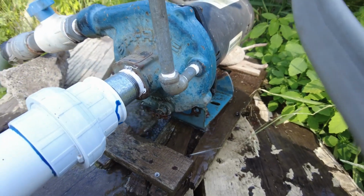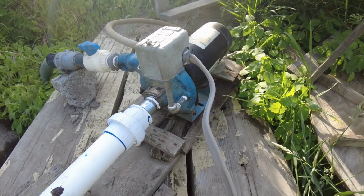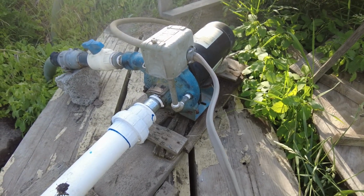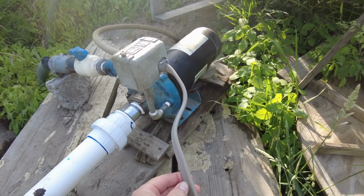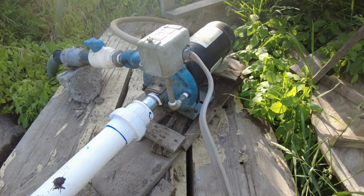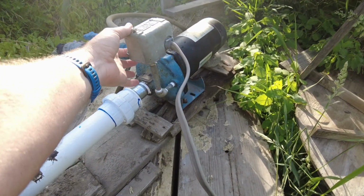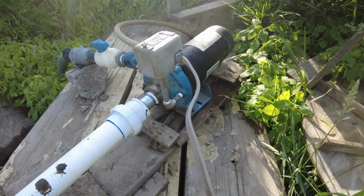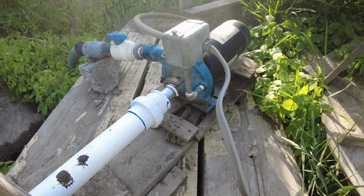So here is the pump, and I'm going to do my best to do this on site here so that I don't need to take off those wires. I'm going to verify that the main power supply is unplugged. It's obviously not running now, but it still could have power. Of course, I can flip this and I know there's no power, but I'm still going to be extra safe on that and make sure that I just totally unplug it.